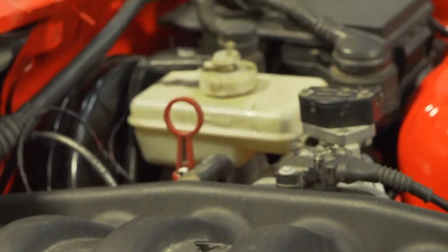I got all the brakes on the car, front and rear, and it's looking really really nice. Now it's time to bleed them. The theory behind bleeding brakes: start on the farthest corner from the reservoir, which is the rear right. Fill the reservoir with fluid, have somebody in the driver's seat pumping the brake pedal, crack the bleed valve open on the caliper, have them press and hold the pedal, then close the valve before they let off — that forces fluid through and pushes air out. Work your way through all four corners until you have a firm pedal. We're hearing an air leak over in the brake booster area, so we're going to look at that another day.